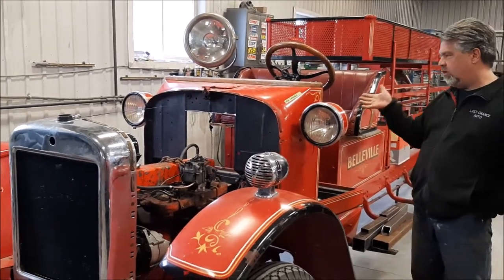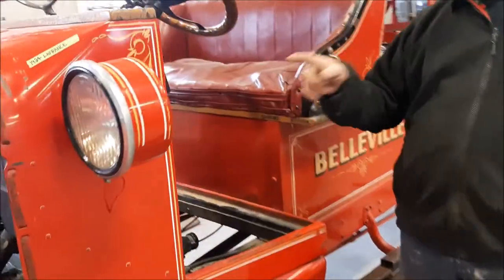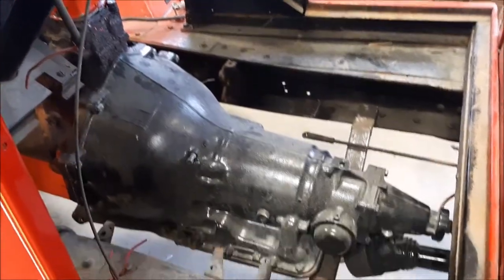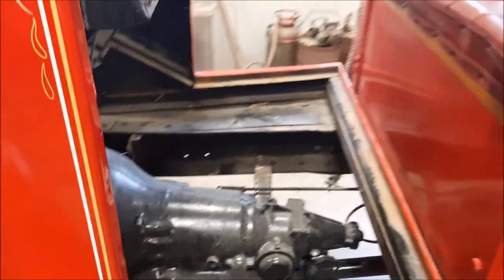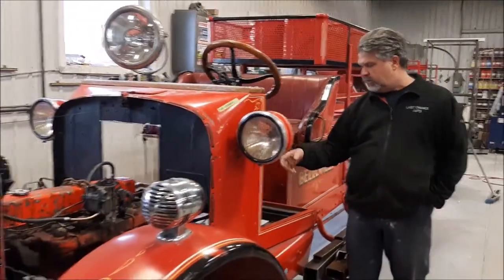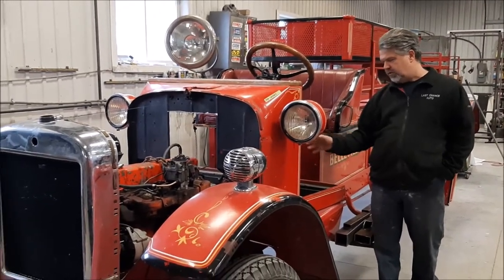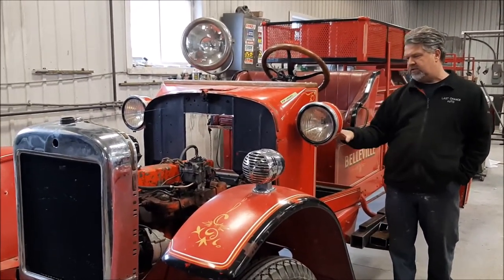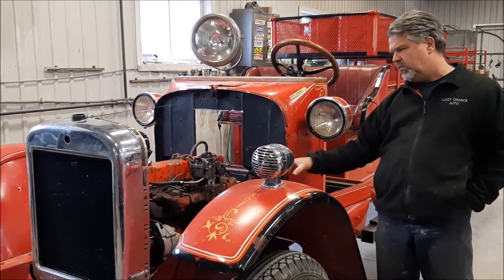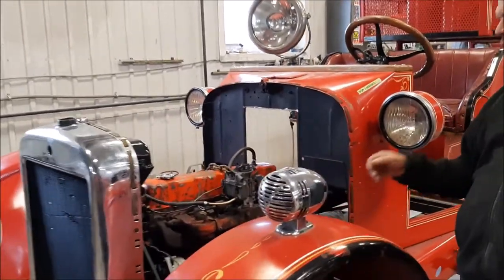In an earlier video, if you recall, on this 24 Lafrance, when they did the mock-up trying to use the 4.3 motor, they had this Turbo 350 automatic transmission. It looks like it's rebuilt and quite fresh. It has a brand new torque converter with some numbers on it. We're obviously going to have to do quite a few changes to the driveline and mounts itself, but this is going to better suit the vehicle. These are very, very reliable engines, and it looks more along the time period of what it should.